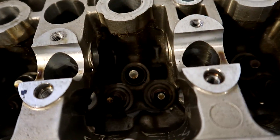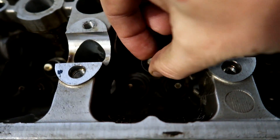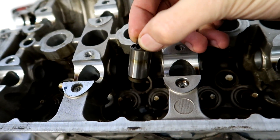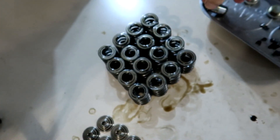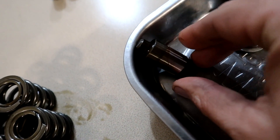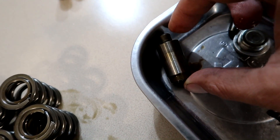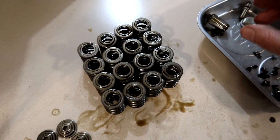All right guys, I've got all the valve springs and retainers removed, the rocker arms are all out, so now we can get to the lost motion assemblies. You can see those in the head here. Normally the rocker shaft is in this area and it blocks you from removing them. This is the lost motion assembly — this is what controls the VTEC lobe when you're not on VTEC. This is the old style, which is a hydraulic style. When you put in higher lift cams, these can have essentially coil bind, so if you have a really high lift cam it's not advisable to use these — that's why I got the newer style.